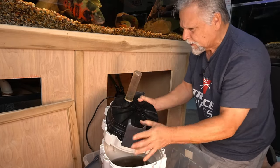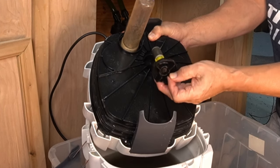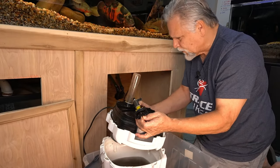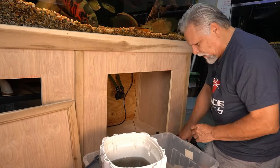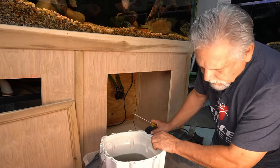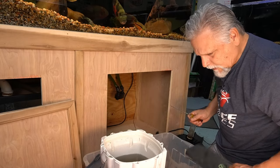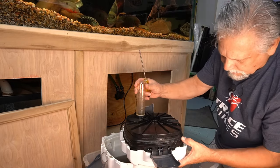Another thing I'll do is service the impeller, which is in this area here. You just pop it open. You can see it has a pretty heavy-duty magnet — not as heavy duty as what you get on a Fluval, but still pretty good. The housing isn't that dirty, but the magnet's got a little gunk on it, so I'll clean that up. My number one suspect in the leaking issue is the O-ring. The body of the unit doesn't seem to be leaking from below, so I'm pretty certain my problem is how the main motor unit is sealing — or not sealing.